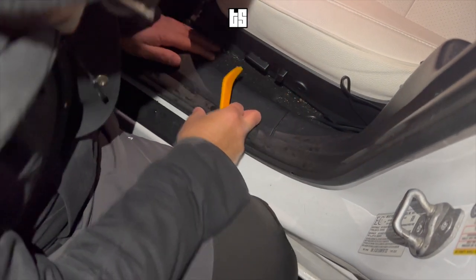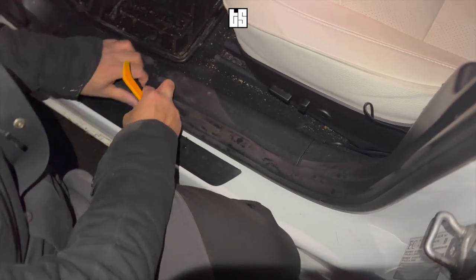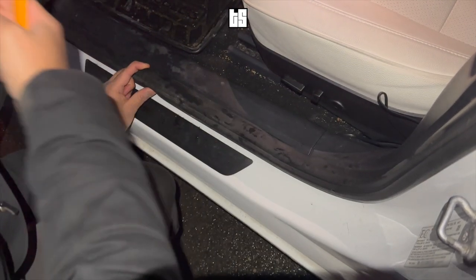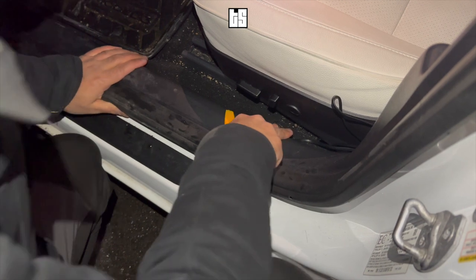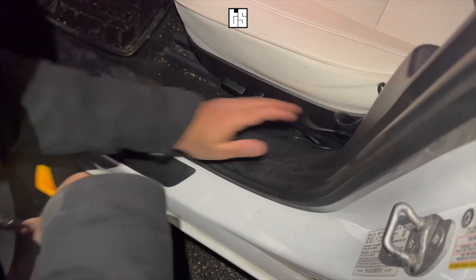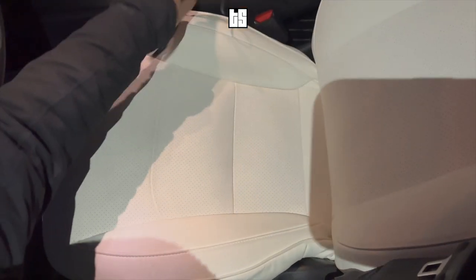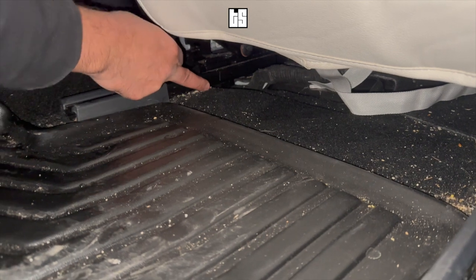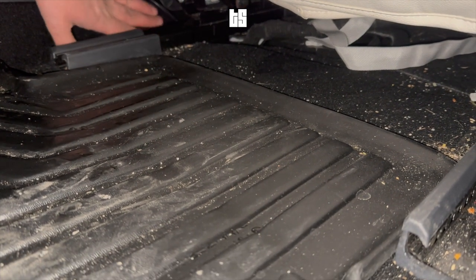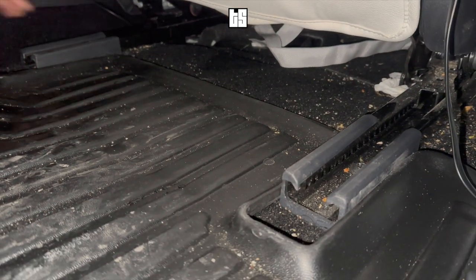The wire cannot just go underneath the seat — it has to go underneath the rails. There is a gap I'm going to show you right here. Disconnect these wires and connect them at the bottom. There's a dip underneath where the rail is raised, so the wire goes underneath the rail where that little gap is. This way we make sure the wire is never interrupted.